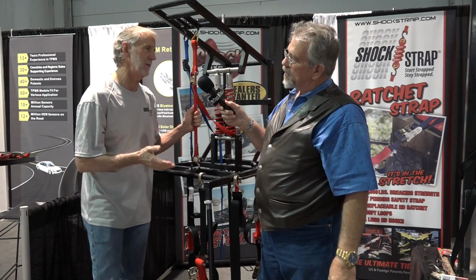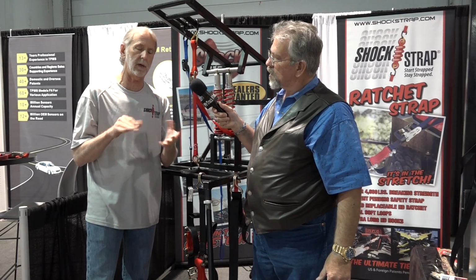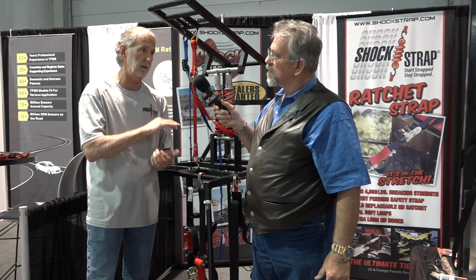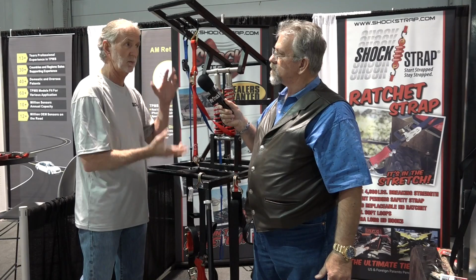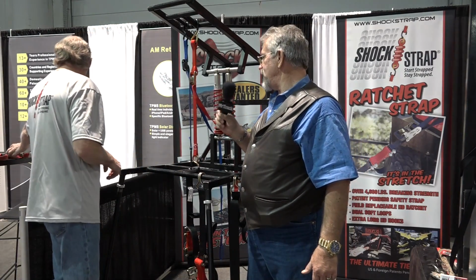The amazing thing, people don't realize this, but when you strap below your springs, I completely get it, but your tires on your UTV or ATV still have very little pressure. So they act like a sponge. They're constantly flexing along with your trailer. They can still bite you even when you strap low. So it tends to hide a lot of sins. In other words, you can pretty much strap it anywhere. There's always tension. So yes, this is a much safer way to do it.